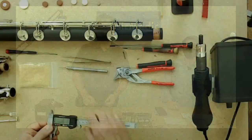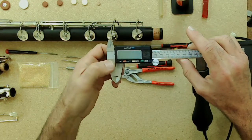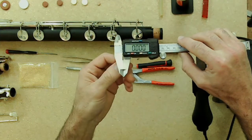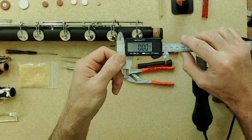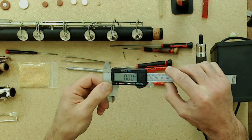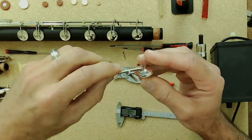The most important tool you're going to want is a digital caliper. This one reads both metric and standard, but the easiest for me is to use metric measurement, since most pads and pad cup measurements go through the metric system.